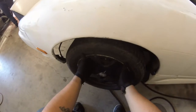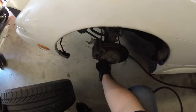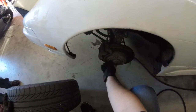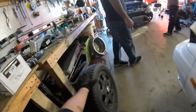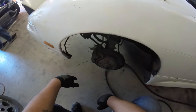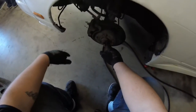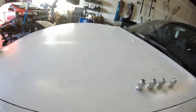Ooh, there's frame damage. Oh, she's got some. Oh, look at that. See, that's a rear stud in the front hub. I just talked about that. Don't forget yours and pull this deal. This is what I was talking about. Nope, shit, I lost it. So yeah, I'm gonna fire this guy off. This looks bent. Right here, I think it is. We got a little bit of frame damage right there. Yeah, that doesn't look like that's supposed to be bent like that. Check the other side.